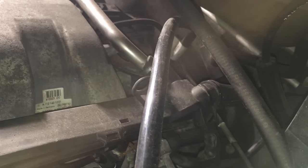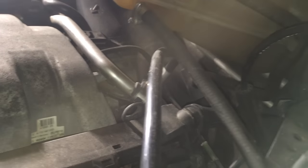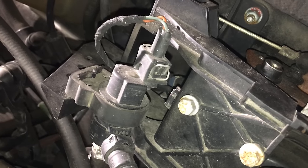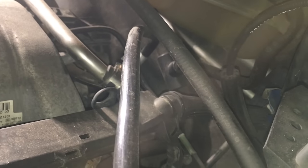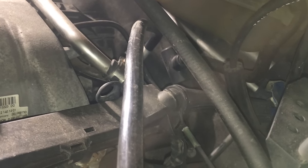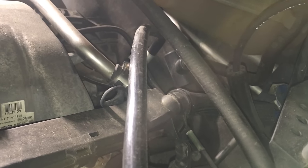Leave it that way and come listen for the throttle body to move. That's where the throttle body is — it's electronic. I'll actuate it so you can hear it. You hear that clicking? That's basically the throttle relearning idle — relearning where the closed position is.